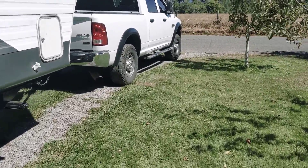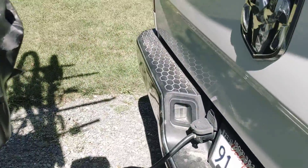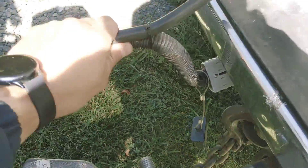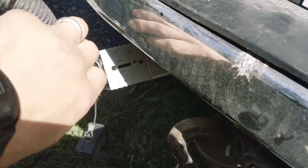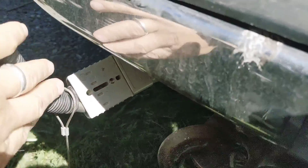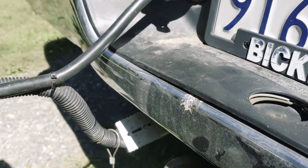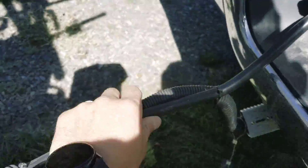Lastly, let's talk about the higher amperage charging from the truck, which is this cable here. It has an Anderson connector — I can detach it from the truck right there. That corresponding one goes up to the front into my battery bay, where it's connected by a solenoid to the batteries. This just goes under and connects into the battery bank.